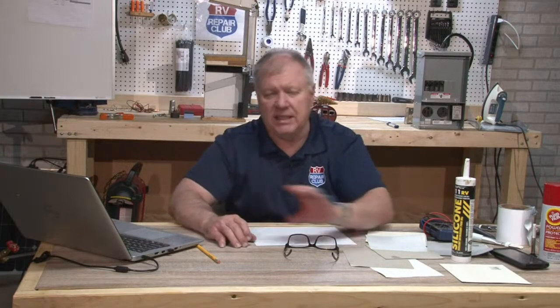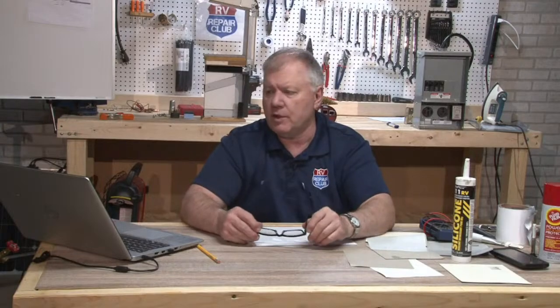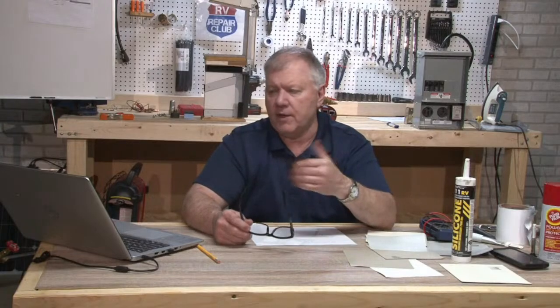That's a big thing. Seal it really well first. Maybe put Eternabond, bottom and top on that corner edge, and get a nice seal so you don't get any moisture penetration coming up inside, because it's going to wick in there and then start to rot the inside of your front wall of that unit.